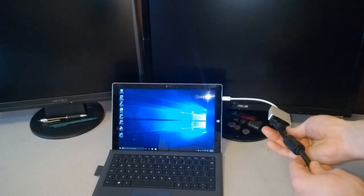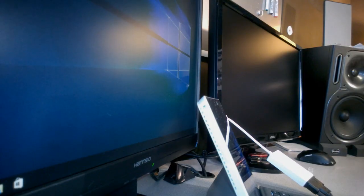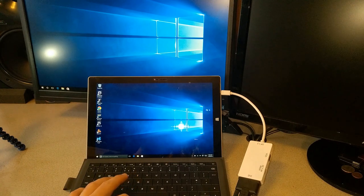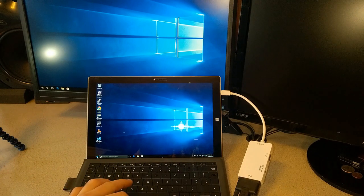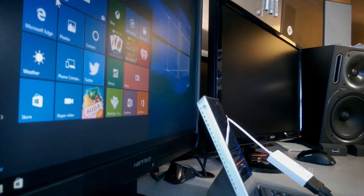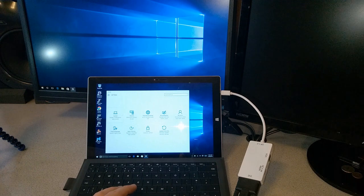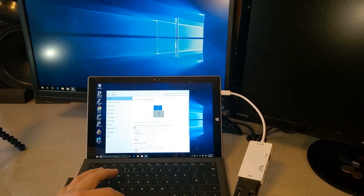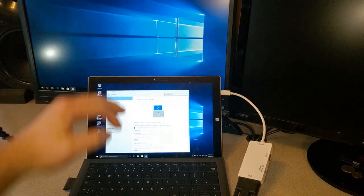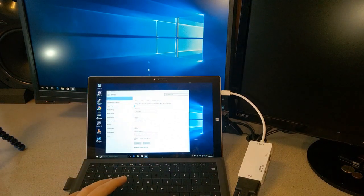Hopefully you heard that tone and can see that it does indeed work. This is currently set up as a separate monitor — as I get towards this edge I go over to the next monitor. Going to the Start screen and then to Settings, then System, you can see how the monitors are set up. The Surface is one, this is two. We can orient them differently — maybe we want this screen on top.